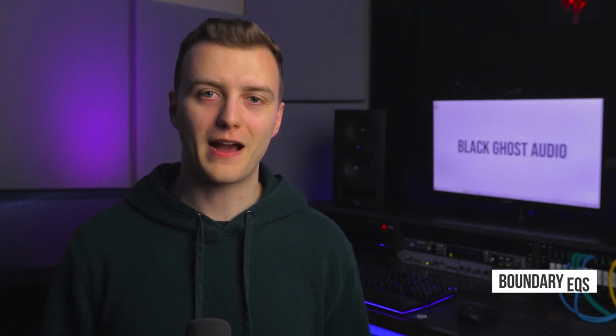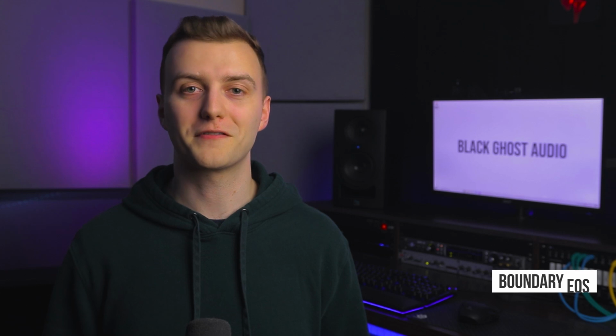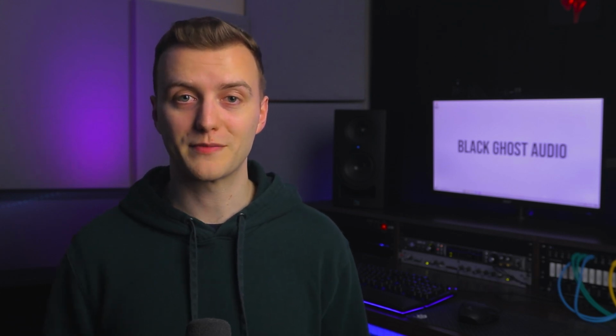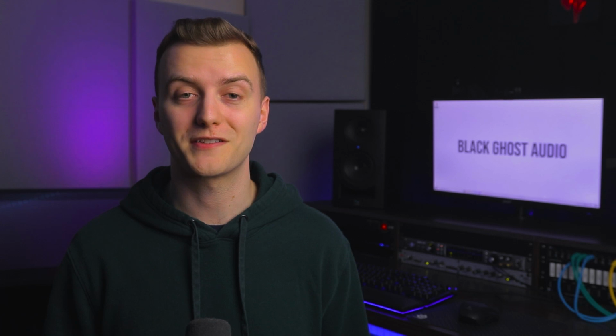Studio monitor manufacturers are starting to build EQs in their speakers that provide a surprising amount of control. A built-in EQ can help you achieve a near-flat frequency response at your listening position by compensating for the way the sound produced by your speakers interacts with the surfaces in your room.